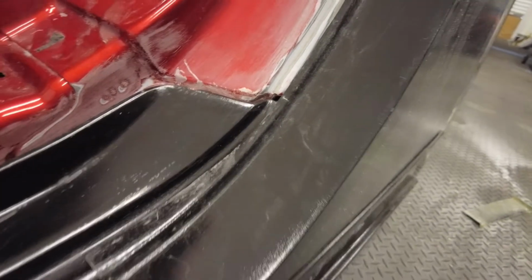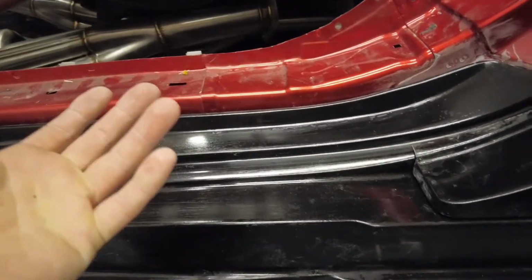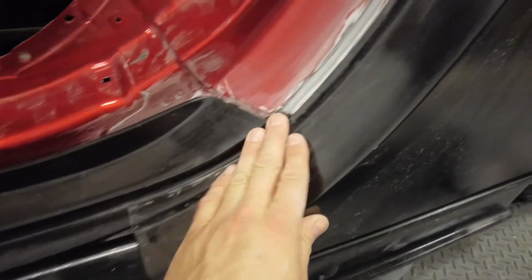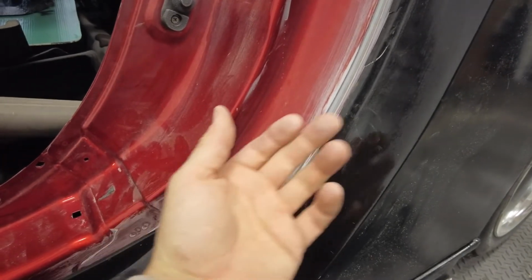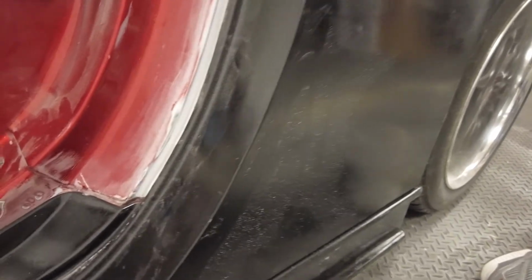Obviously when you buy a body kit and people say, oh, it needs work to make it fit, this is exactly the same. It's all from the mould, the outside shape's fine, but it's the inner side when you're building it up with the fiberglass, you're maybe making some areas too thick, and that's what needs ground back. There are areas like this where I've maybe ground it back too much at the back, so I'll put a bit of filler at the back and reshape it, but in the meantime I've made it too thin, and when you're handling it, it's just broken wee places. So that's a learning curve for me. Obviously I'm just being a bit too rough with it until I get it to where I want it to be.